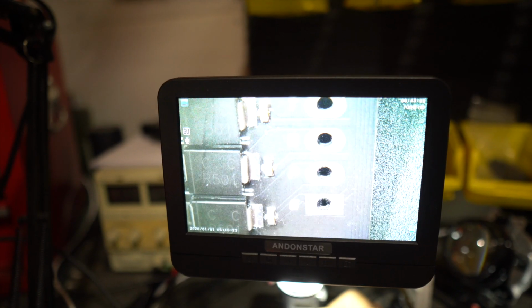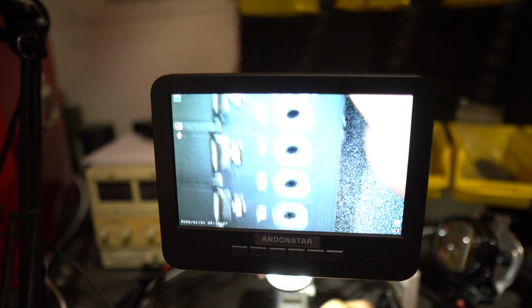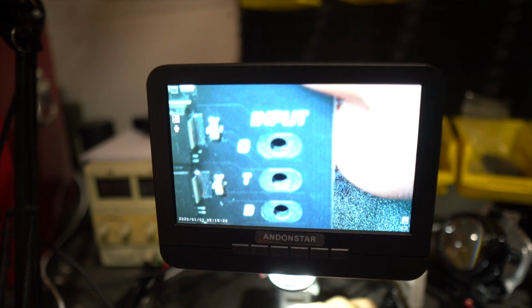We've got these inputs right here. We've got ground on the bottom, then parking light, then brake, then turn signal, and then we have O. But what is O? In the current version of the version 2 sequencer, O is not programmed, but it will be an optional thing later for things like show modes. So let's talk about all the other modes that it does have.